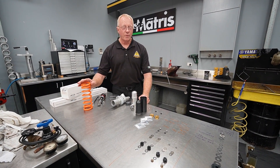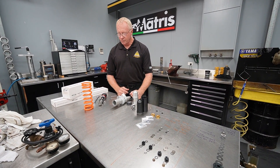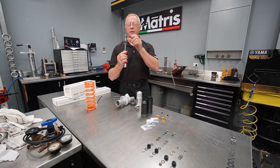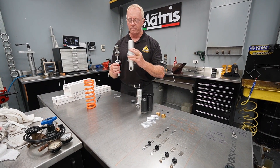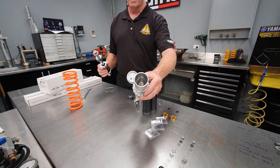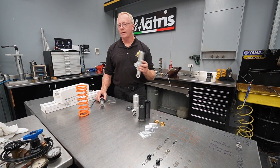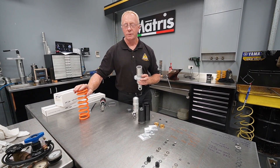I know people will still argue about straight rate springs — here's the deal: we put these things on and go straight around the track and test, and we get a great result each and every time with a progressive spring. If you want to stick with your straight rate spring that's up to you, but you will be better off with that spring. Now, as I've mentioned previously, this is a two-piston shock absorber — we have the primary piston and the secondary piston. The secondary piston, as the shock compresses, is not being acted upon until it enters the cup in the shock body itself, and once it enters that cup it gives us a secondary damping stage.